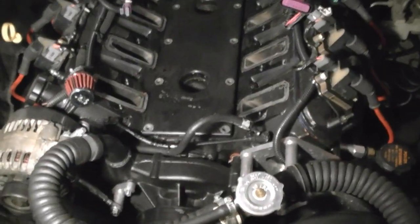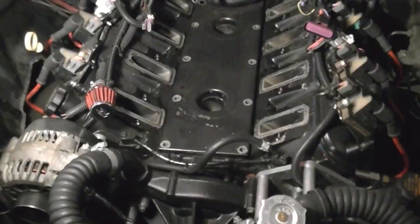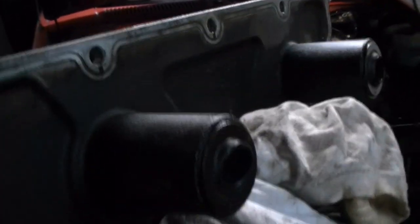This other step is completely optional but recommended anytime you do an intake or you're pulling a motor apart. Run the shop vac through just to make sure you're not going to drop any dirt into the intake runners or into the valley. Just a little bit of extra protection for what we're doing here. Be careful where you pry, but now the valley plate should just come right up. You're just fighting the seals. And just like that, here we are.